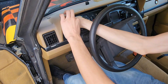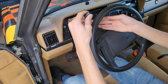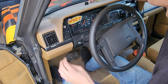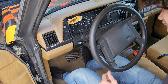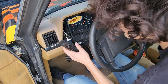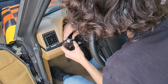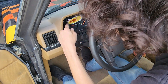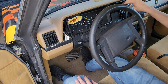Pull off the dimmer one — this is a little bit hard to get off because it's a little bit smaller, but still notched like the other one. Go ahead and set it up top or in the tray on the right side of the dash; it's super helpful for this kind of stuff. Now we can pry out this face plate here. We'll disconnect the fog light switch — get the bulb and the switch disconnected. You can see there'll be two Phillips screws on this side to remove the panels.